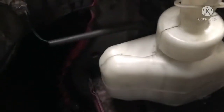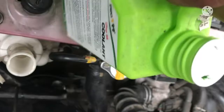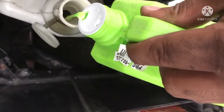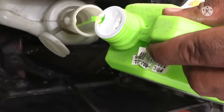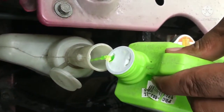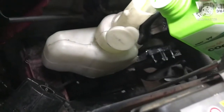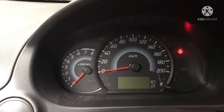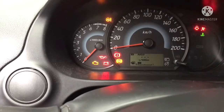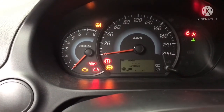This is part of our PMS — let's check the coolant. It's running low. This Mirage has a history of overheating — the radiator was damaged. I brought it to a mechanic within NCR and all he did was remove the thermostat without properly troubleshooting it. That was just a workaround, but the car still overheated — turns out the radiator was clogged. This is proof it's been driven 60,000 km; I just went a bit past 69 km during a live session.